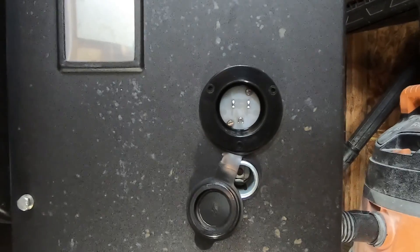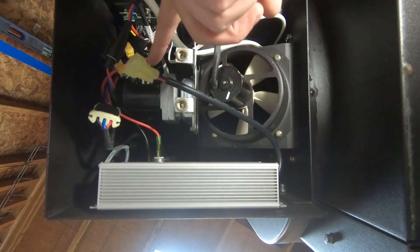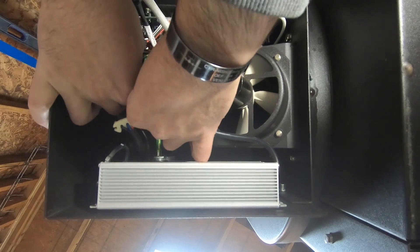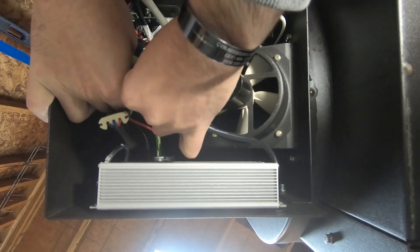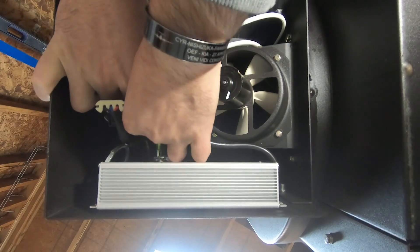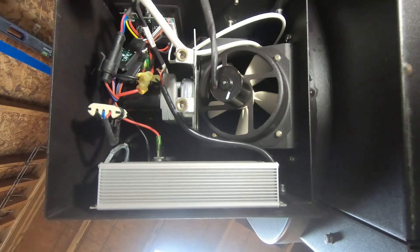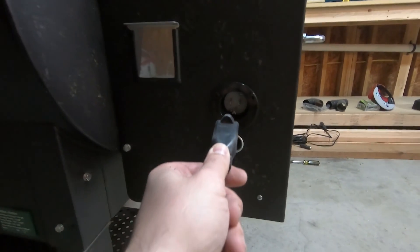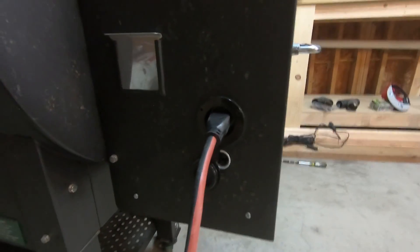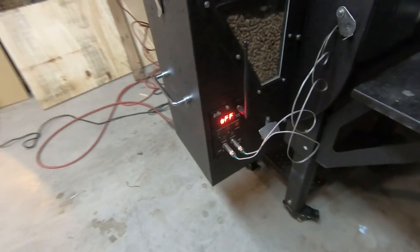And it should look like this when you are done — there it is, nice and mounted. Under the hopper again, we see the female side of the T-taps were placed on that black and red wire that I pointed out within the grill earlier. I'm just plugging in the male side of the T-taps into that female side. One of the T-taps came off — I did go back and recrimp that later. Again, I'm gonna change these out for posi-taps. But that was the last step. With any luck, we plug this in and we should see some lights on the front. Our 12-volt grill should now be 120 volts. Last thing to do is bolt the grill grate we took off back underneath.